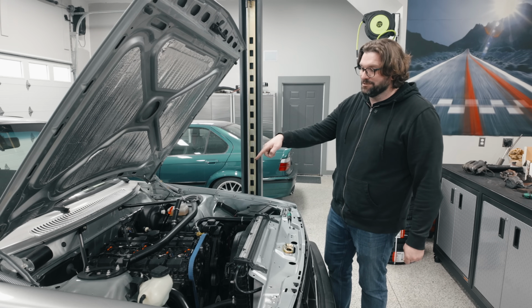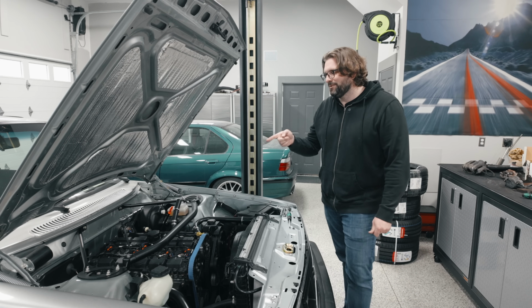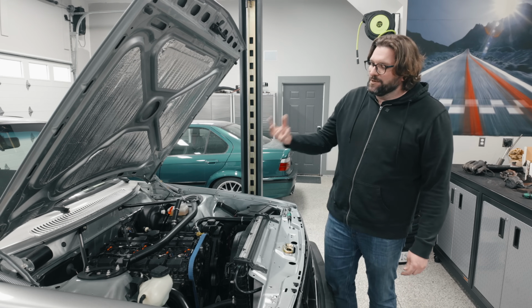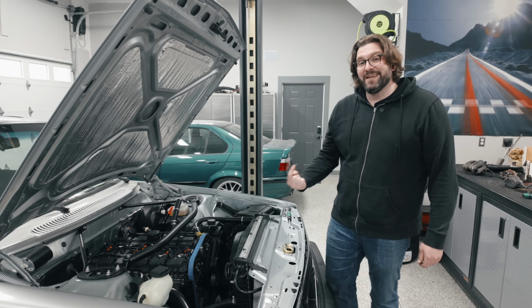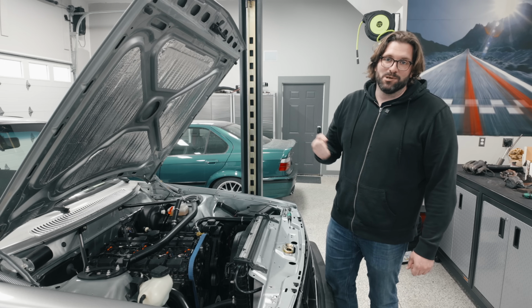That damage in cylinder 5, which is the one that I didn't have spark on and had to replace the spark plug for, that foreign object that was in there must have hit the spark plug and closed that gap and killed that spark plug.